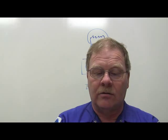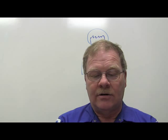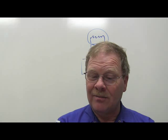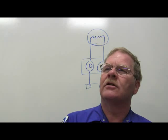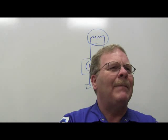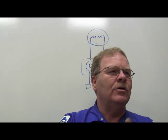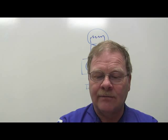All right, now then. Air-fuel ratio is described as what? A, the proportion of air to fuel by weight needed for the gasoline engine to run; B, the proportion of air to fuel by volume needed for it to run; C, either A or B; D, neither A or B. B, volume? Oh, goodness, you got 9,000 gallons of air, you got 1 gallon of fuel. How do you do that? Anytime engineers work with gasoline or any kind of fuel, they always use weight as their basis for measure. On air, you do too. 14.7:1 is your air fuel ratio by weight. 14.7 parts of air to one part of fuel. That's stoichiometric mix, you heard it in emissions when we were in there. Okay, 14.7:1 is the air fuel ratio that's the cleanest burning with the fuel we got right now.